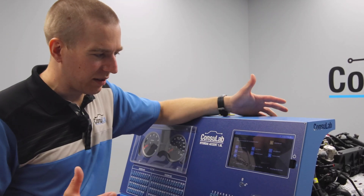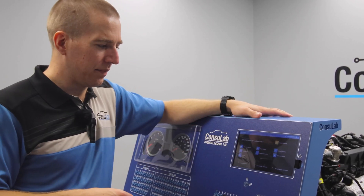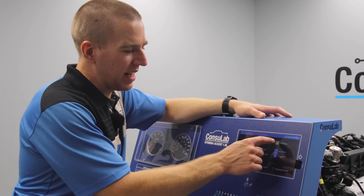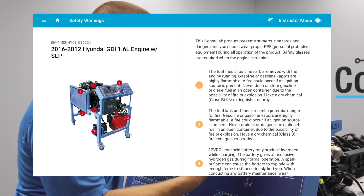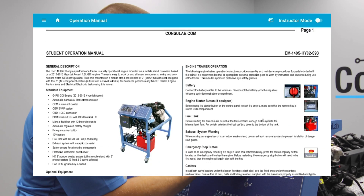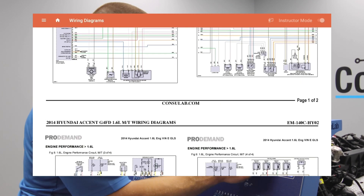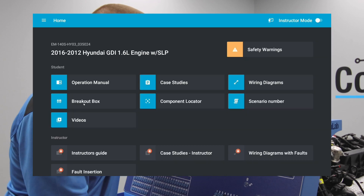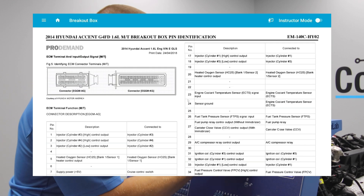Here I'm going to dive into some of the details from a student's perspective. A student walks up to the bench and now has access to all kinds of great information. They can get into safety warnings — important safety warnings about the bench, learn about the emergency stop, learn about the hot rotating components. They've got access to an operation manual, access to wiring schematics. So for engine performance wiring schematics, they can pinch and zoom, get the wire colors, pin numbers, all the information for the engine performance wiring diagrams. They can also get information about the breakout box — all the pin identifications are right there.